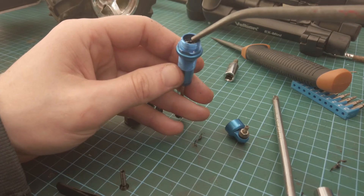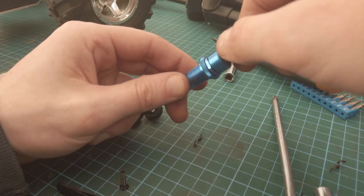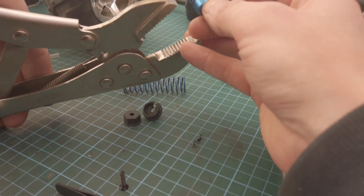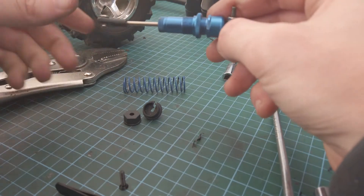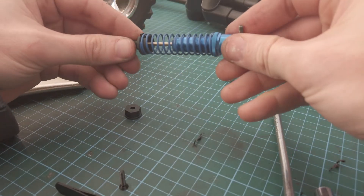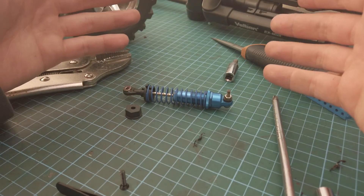I'm not sure I can show that without spilling this everywhere. Got the top back on — this is going to make a bit of a mess, it's a bit awkward trying to film this. Let's tighten that down — that seems to have done the job. Chuck the spring back on, and the boot. That is much better. I think I'd better go around and do all four shocks just to make sure they're all full of oil and working the way they're supposed to be.